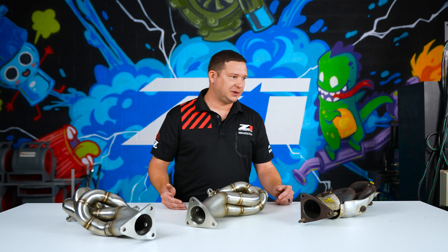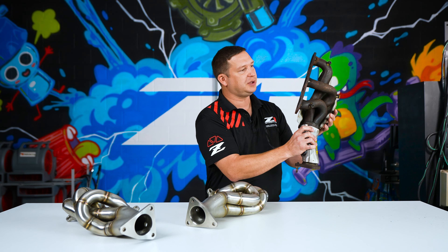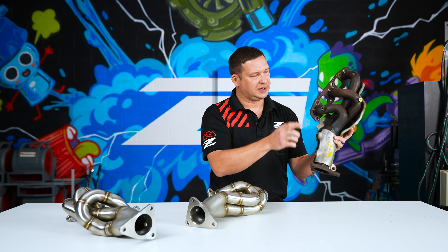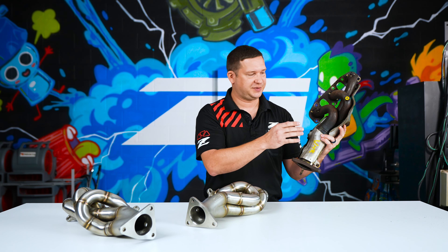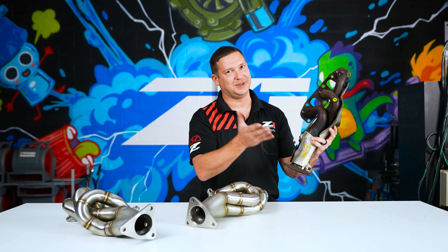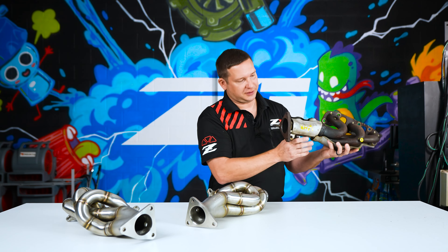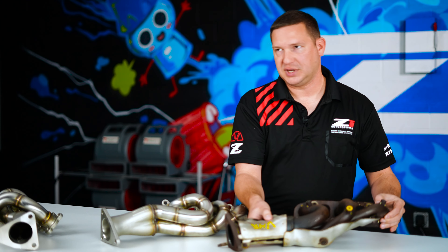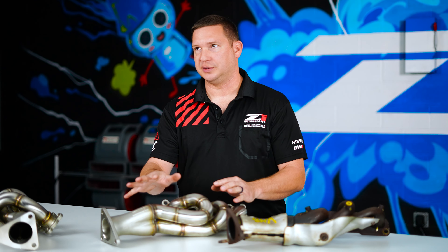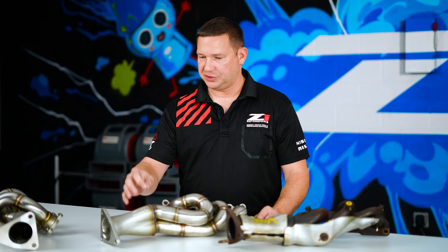The flange on the collectors is also beefed up compared to the factory manifold. The factory has a mass-produced piece — they did go from sheet metal stamped to a more tubular set, which was an improvement — but the pipes are often crushed, they're not equal length as far as the collector goes on the OEM products. Even after the update it's not a true collector — it's just pipes jammed together in one near zone and welded up. These also have a multi-layer construction that can fail or come apart if you're trying to use a single turbo kit or something like that. You're not going to be at as much risk with something like this — it's built all 304 stainless, mandrel bent, with back-purging construction, so really good penetration and very clean weld work.